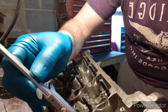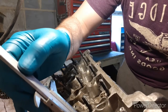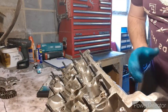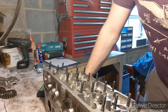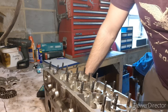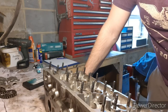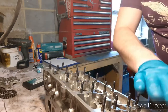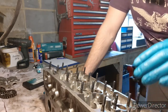There's not a lot of tolerance allowed within the face of the head — I think there's only 0.1 millimeters distortion allowed, which is next to nothing. So the measurements we've got are 118.1, which is exactly what is in the manual. From there we can confirm that the head hasn't been skimmed, because if it had been skimmed it would read under 118.1, which would change the compression ratio. It will probably have a light skim before it gets refitted eventually, just to make sure the surfaces are perfectly flat so the head seals properly.